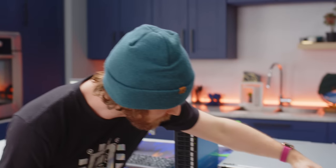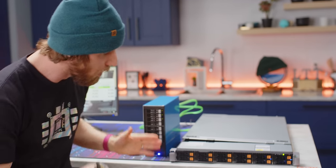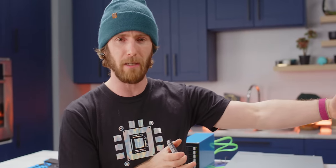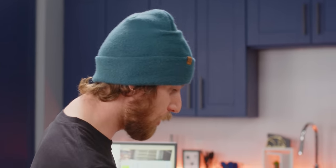So for the data center, these are gonna be huge, not just because they have a single connector that natively supports multiple protocols. That's not anything new. We already showed that with SATA and SAS. The big deal is that it allows a single server with a single type of bay in the front to serve all kinds of different roles. So manufacturers, instead of having to have different SKUs for a slower bulk storage box and then a faster all NVMe one, are gonna be able to have just a single SKU, simplifying their product development and simplifying their product stack that data center administrators can just deploy however they want.